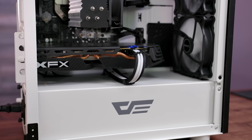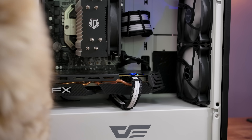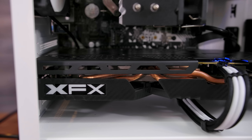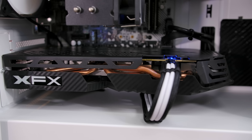I think we'll start right here in the middle with the graphics card this all started with — the XFX RX 580 XXX 8GB edition that I originally put into this PC. The RX 580 is based off AMD's previous generation graphics architecture, Polaris, running the 14nm FinFet. It features 2,304 stream processors running at a boost clock of 1,366 MHz and 8GB of GDDR5 running at 8,000 MHz. This particular RX 580, the XFX XXX edition — yeah, that's just as difficult to say as it sounds — features probably one of the more polarizing graphics card looks on the market with its carbon fiber and cutout shroud design. From all the comments I've seen online since its release, this really is a love it or hate it type aesthetic. I personally dig the look, and if you design a system around it, it can really complement a system.